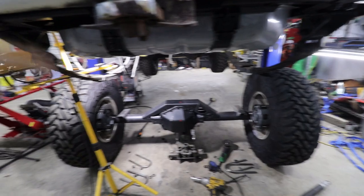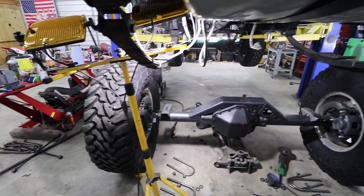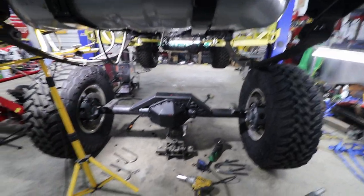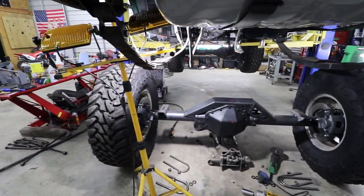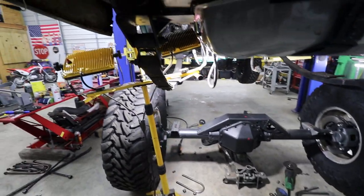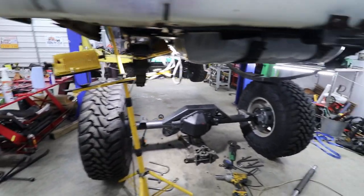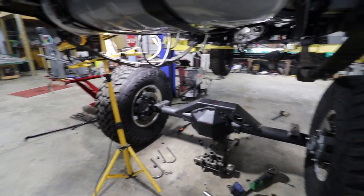So now that I've got the Jeep off of the axle, I'm going to go ahead and weld these perches in fully. And I'm going to do just like I did the truss. I'm just going to do maybe stitch weld, jump around back and forth, let it cool, just because I don't want to heat up that axle tube too terribly much. And one welding tip, I'm by no means a professional welder, but what really helps me out is lighting. So go ahead and get some good lighting if you're going to be doing this, because it will definitely go a long way.